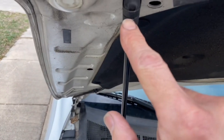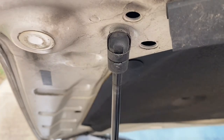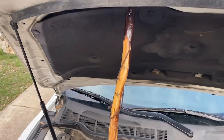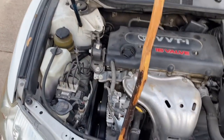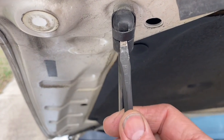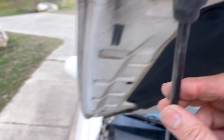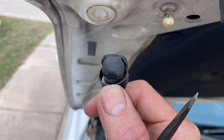So how do you do it? There's a little spot here where you can use a screwdriver on. Before you attempt to take these off, get something that's going to prop this hood really well. If you open it further, make sure that it doesn't fall down. So there's this little clip — get a flat blade screwdriver and pull it out just a little bit, not all the way. It should stay like that, and when it does, it'll pop right off without any effort. To prevent it from shooting out, push it back down.